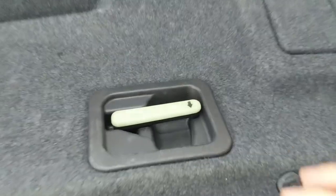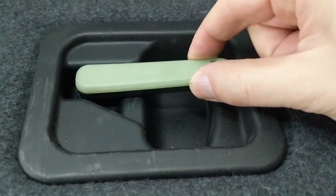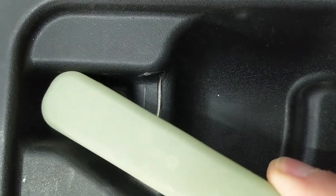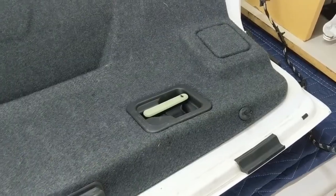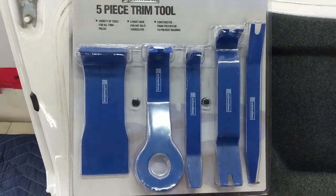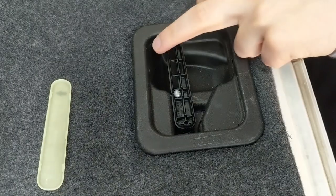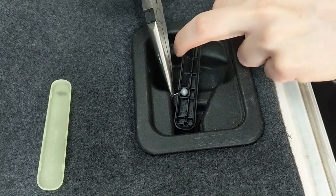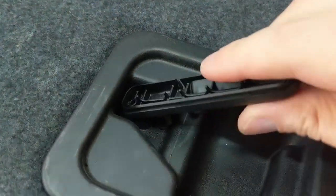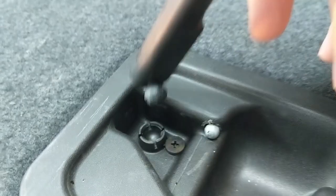The upper glow-in-the-dark portion of the handle needs to be pried up and off because underneath it is a steel ball head that attaches the handle to the trunk release cable. You'll be fine using a screwdriver to pry that apart, but I'm going to use my new Schwaben trim tool kit to avoid marring trim pieces. Then lift out the release and gently lift the little plastic socket from the ball joint out to the side.